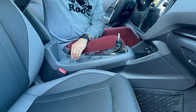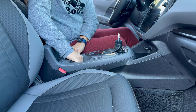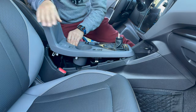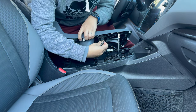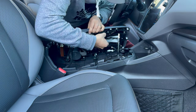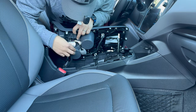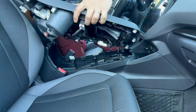The next step is to open this and grab the cup holders. I usually put one hand in the middle and support with the other, and you're going to pull straight up. It might take a little bit of finessing, but you need to pull straight up and the whole console just comes out. Now you're going to have some cables here that you need to disconnect in order to get everything free. A lot of these are just push cables, so you just squeeze and yank them out.